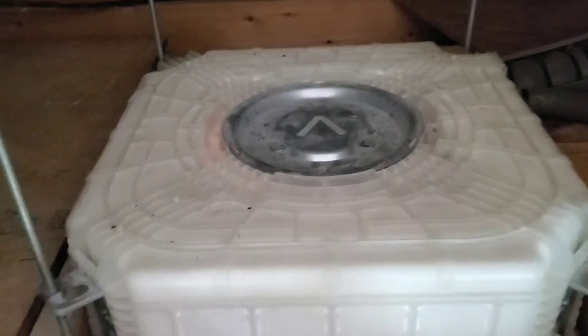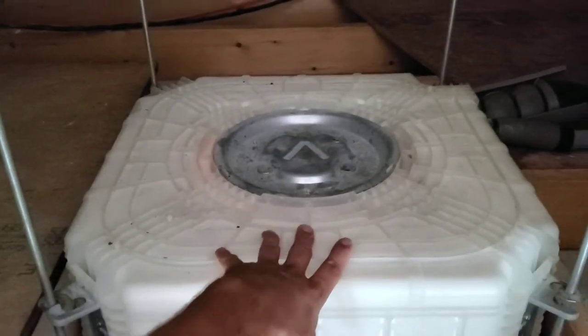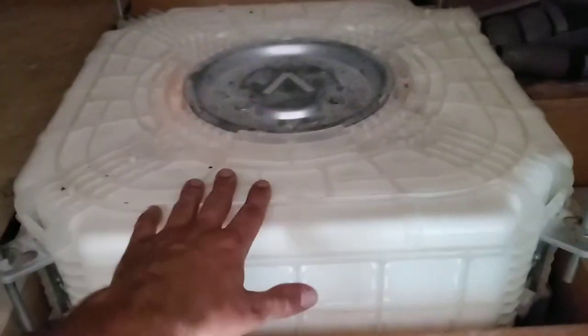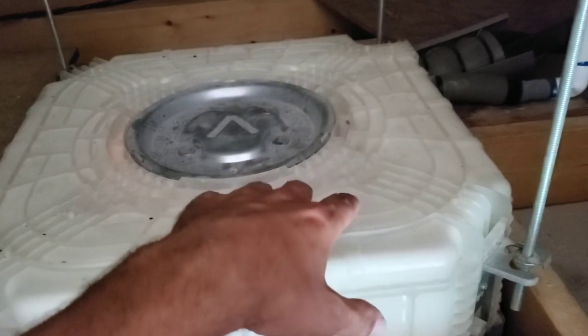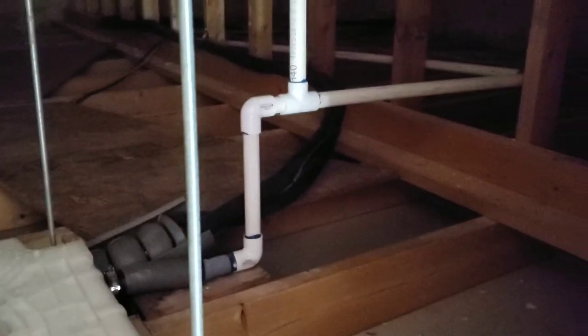Just wanted to show you guys a top view. You might have to insulate this box if it's in an unconditioned attic. This one is foamed — in a foam house you don't insulate the joist because it acts as a vent in the home; air travels up and over through other parts of the house. But yeah, this one was doing a little bit of leaking and I just unstopped the drain, which I showed you in the video. Anyway, it's a four-way cassette — pretty cool.